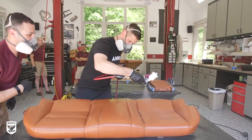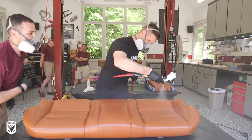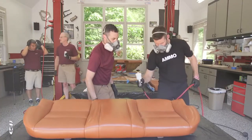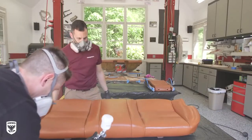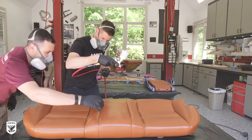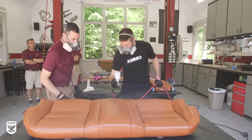On the very last piece, I got to lay the final top coat myself to get a feel for how different or similar this is to painting a vehicle. To me, the same concepts apply: keep your arm 90 degrees from the surface, same distance away, 50% overlap, release the trigger as you come off the part, and so on. Your goal is to avoid runs or thick coats while laying down enough to minimize dry spots or low areas.